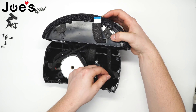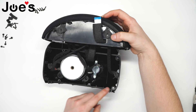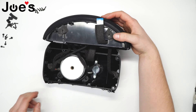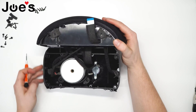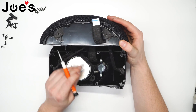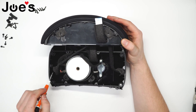Please note that there is a foam gasket that runs along the outside of the speaker. Be sure that stays in place. Also, be careful not to yank at this part — there are antennas that are taped to the housing.